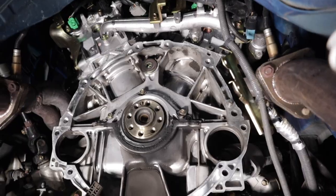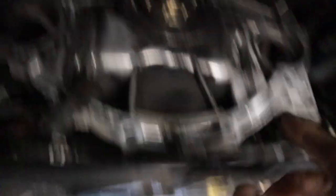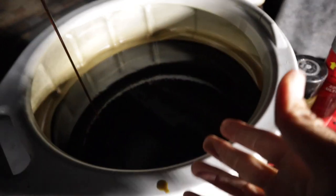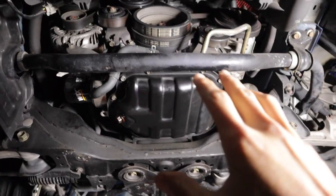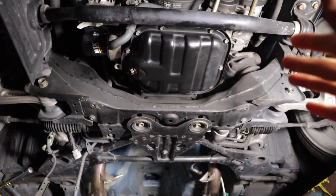We're back — it's the next day. I got three 10-millimeter bolts to take out for the rear main seal. One thing you want to do is drain your oil before you take off the rear main seal. I already got the three bolts off but realized I should drain the oil first because if I take it off it's all going to come out. The oil is pretty dirty. If you want to see my video on how to change oil on a 350Z, go check that out on my channel.